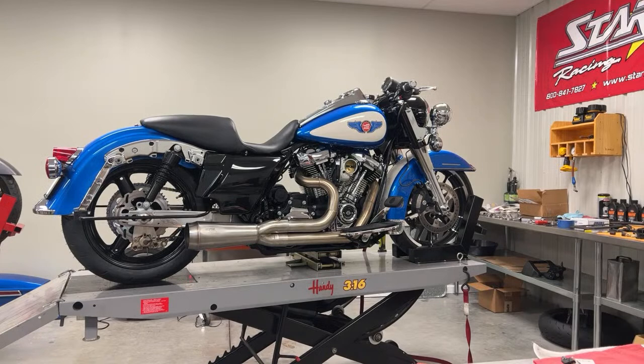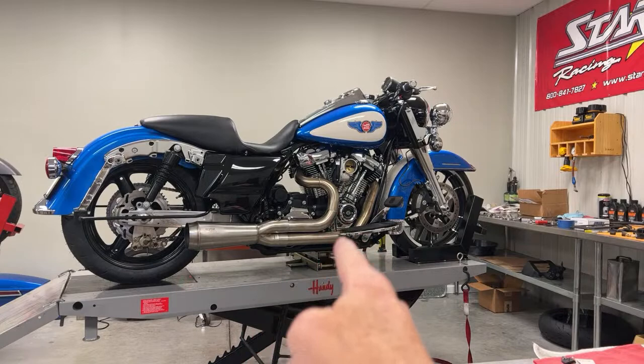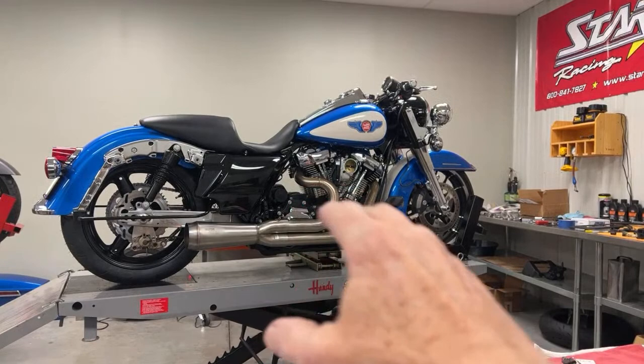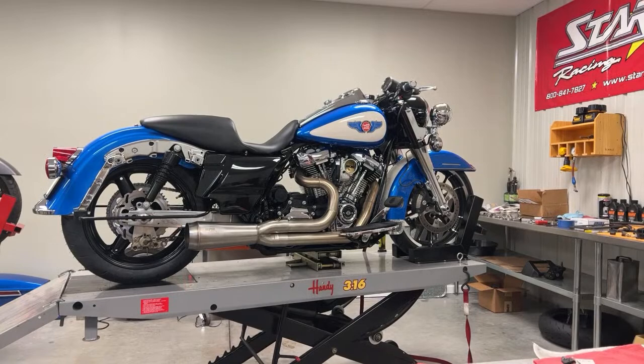And we were having people run down the road that would hold it at say 3000 RPM and go down the road in high gear for a long time, maybe 20 minutes, and it was pumping more oil to the sump than was getting recovered out of the sump back to the tank. So we had the sump filling up with oil, and it was beating air into it and turned it into like a blender. And of course the engine would run hot and the crankshaft was getting beat up with tons and tons of oil. We would probably have a couple of quarts of oil in here.